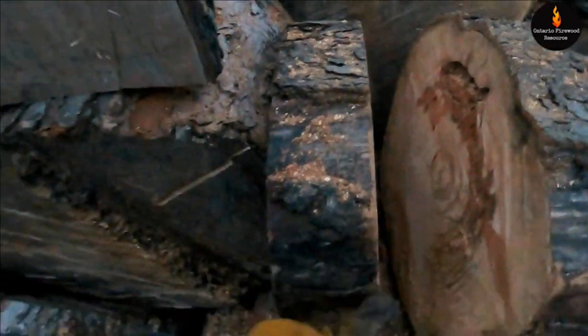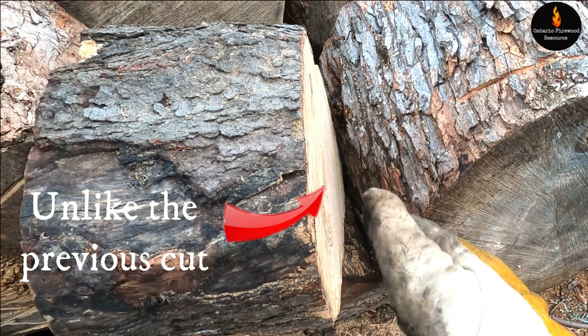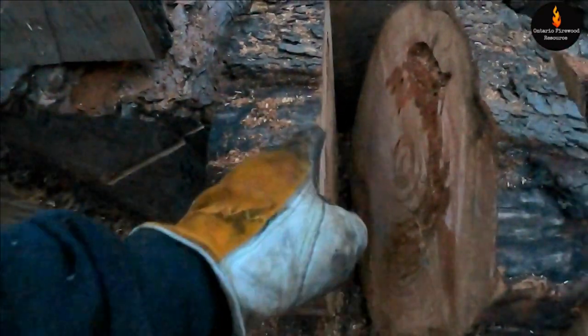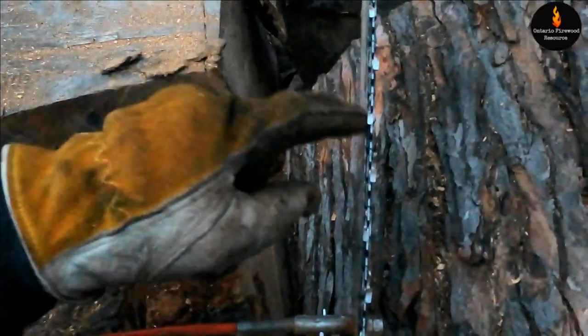It appears I didn't have the camera rolling, but look at that cut — that cut is nice and straight. You can see it's not curving down and going to the side. If you look at the block overall, this cut is maybe a tiny bit wider at the bottom than at the top, but it looks pretty perfect up here, and you can see down at the bottom it doesn't have that bow coming out from the side. You can tell I sharpened the saw pretty good because it just buzzed right through. There's a little bit of rot here so it went through a bit easier, but that was a nice clean cut. I did a good job sharpening that saw. This side had the longer teeth, so I made all these teeth the same length as the left side — it was the right side that had to be filed down to match the left.